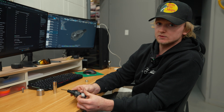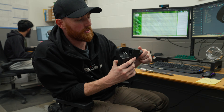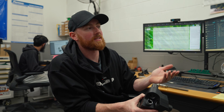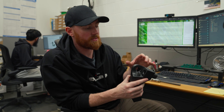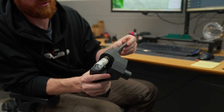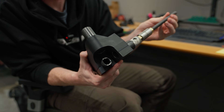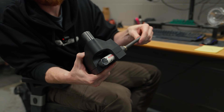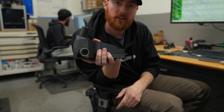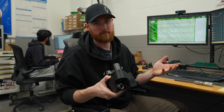Glad we could add that to the product list. I was really busy but the one cool thing I did was make tubular control arms for the C6 Corvette. In high production we'd get these CNC bent and laser notched, but for now I've 3D printed a jig that holds the arbor and hole saw to make the cuts we need — one cut at a very particular angle here, and another at a particular angle, so as long as the tube has a 20-degree bend and is flush with the end of the jig, the tube will perfectly fit into a Corvette after we weld everything up.